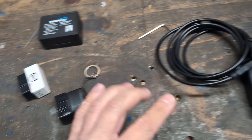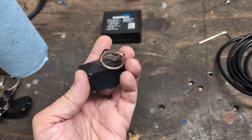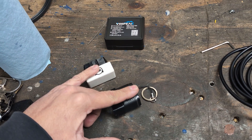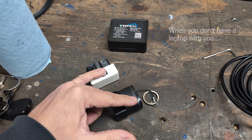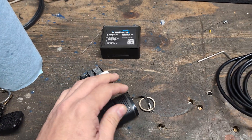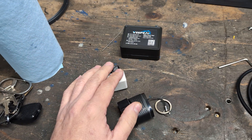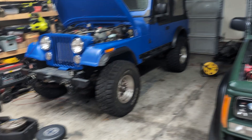This is the closest thing you can get to VCDS — it isn't VCDS. I was having issues with this device not connecting to my iPhone, so I switched over to a Google Pixel 8 Pro, which is what I'm recording on now. I now have both of these, one in each of the swaps, in addition to one of these. This is going to give you the best bang for your buck when it comes to diagnosing specific Volkswagen codes. You cannot graph the actual TDI timing, so for that I'd prefer one of the cables, but in a pinch you have the ability to read codes, which I think is very valuable when you have one of these swaps.